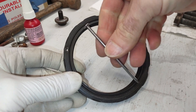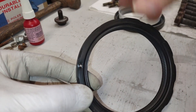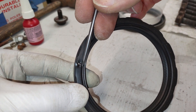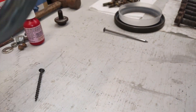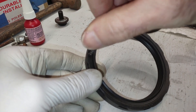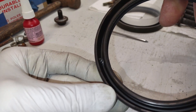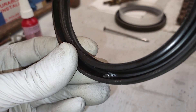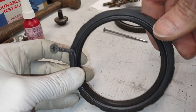I had this big 3-inch nail, heavy duty, and I just put it in that area — kind of in the middle — and poked a small little hole. Then I took a little 2-inch grabber type screw and just threaded it in there, not very far. It's just kind of right in that middle area. Then I used my claw hammer and just clawed it up against the crankshaft, and it came right out.